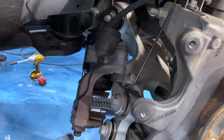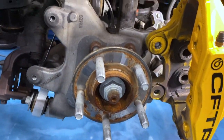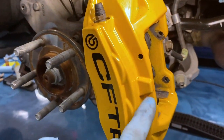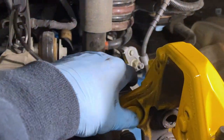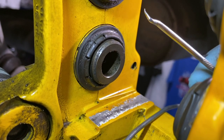You've got to remove the electronic parking brake. These are the bolts that go on the back here — not these little star-looking bolts on the front. These are 13 millimeter; those are pretty easy to get out. The big 18 millimeter bolts on the hydraulic caliper are going to probably require a breaker bar — they're in there pretty good. I've got hangers to hang the calipers. To get the brake pads out you've got to pound these pins out towards the fuel tank, slide out that retainer clip, and get the pads out. Then I just loosely remounted the caliper back into the hub so I have it secure while working on getting the dust boots out.